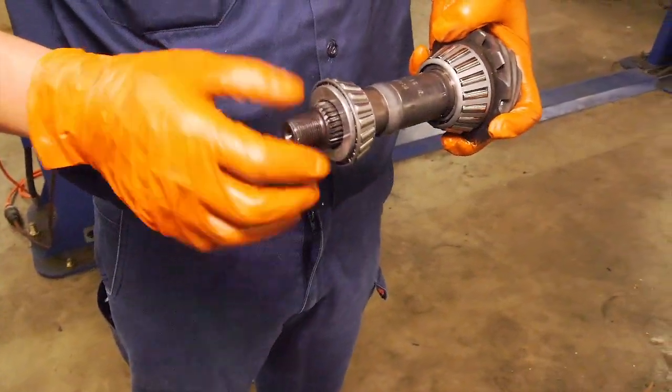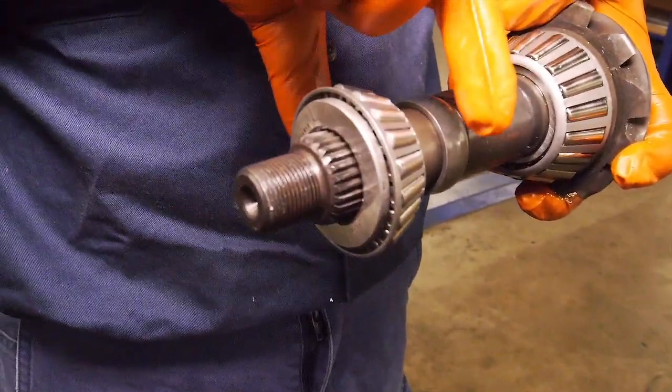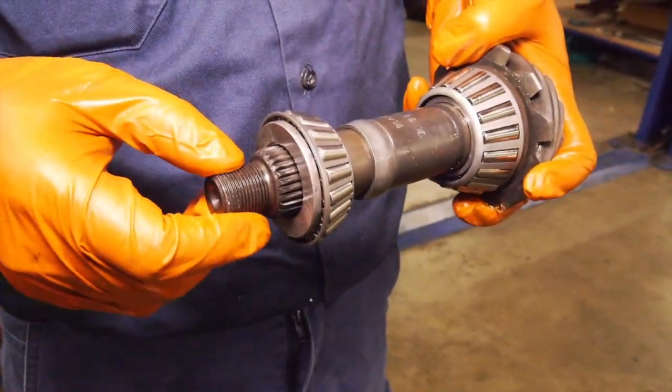As we wind the nut up, it pushes this bearing inner race up against the outer race and starts to preload the whole assembly. The collapsible spacer provides the force that goes back against the inner ring, and that holds it against the tail shaft coupling which acts as a spacer and a seal wear ring, and the retaining nut. So as we tighten up the nut slowly, this inner race will go up against the outer race, increasing the preload until we're at the right point.